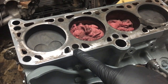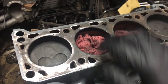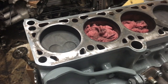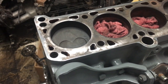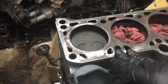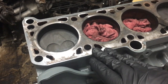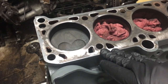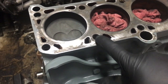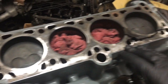An important thing is to clean out all the head bolt holes. You've got two — technically three — options depending on how thorough you want to get. Basically what you're going to do is run a tap down all these holes. Make sure the tap is the same size as your bolt. We're going to run a little tap oil down them, but first I'm going to run a little bit of penetrating oil.